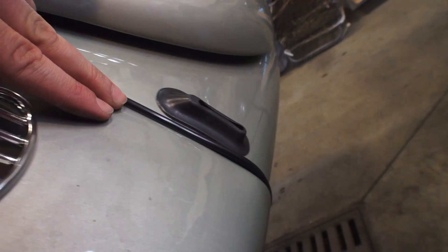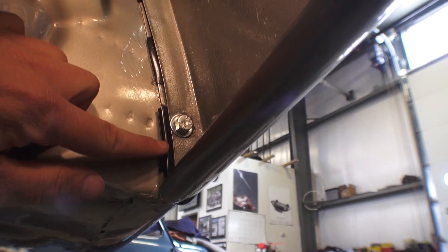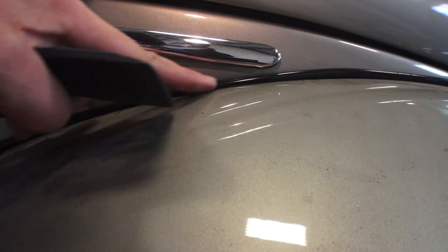As you're tightening down the bolts, look at the outside of the body to make sure the fender bead is nice and flush with the fender and the body — you don't want it dipping or gapped anywhere. You want that rounded finished look at the bottom where you've tucked it in and tightened it down. That is the best way to make it look right.